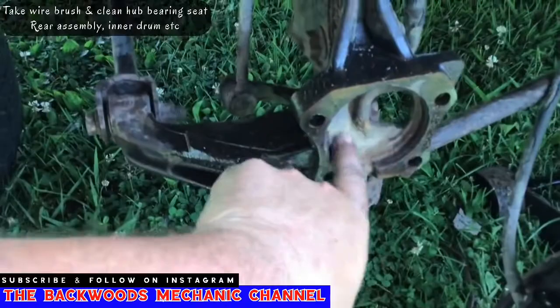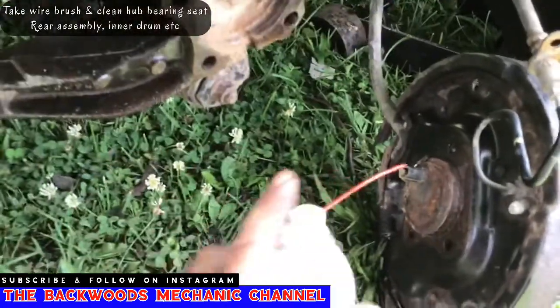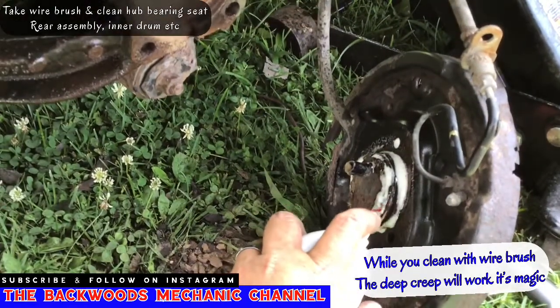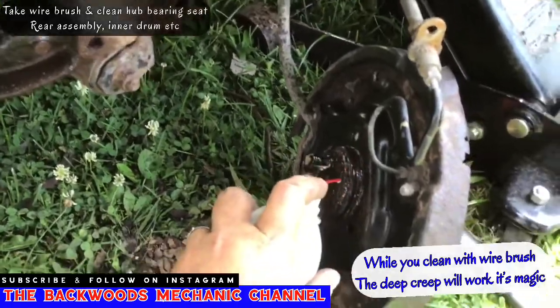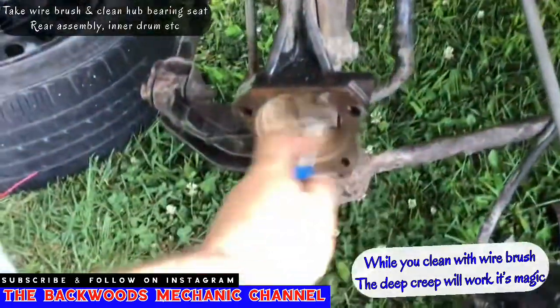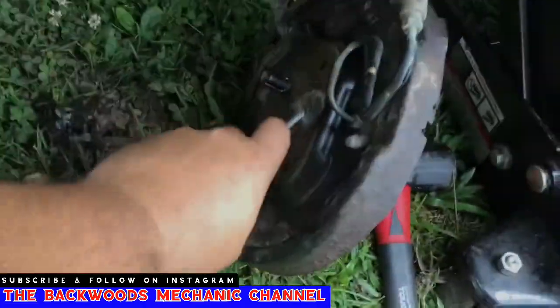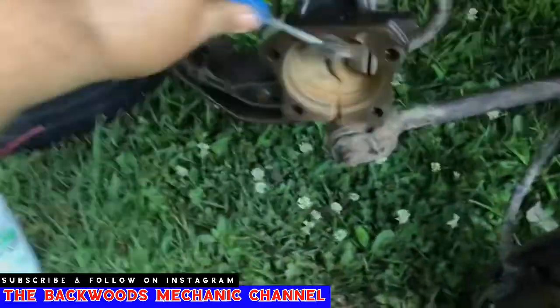But we are going to go ahead and clean all this out with a good wire brush. We're going to try to make this as easy as possible. Brush some more Deep Creep around it because this needs to come out of that housing. We're going to let this Deep Creep do its work, and we're going to hit it a few times with a hammer, and it should pop loose. It wouldn't hurt to do the same thing on the outside of this one while that Deep Creep's sitting in, or whatever you're using for lube. That way it knocks some of the rust off there and it lets it get inside there and do its magic.